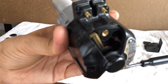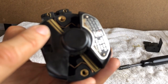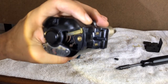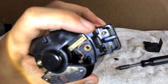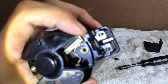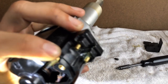You can see the commutator in here. That copper ring is our commutator. On this side I can also inspect the brush. Using a flashlight at the right angle — look where I'm shining the light — the tip of my finger marks the top of the brush holder. Follow that middle line: it's dark, then right around in the middle it starts to look gray, and that's the brush. What a clever thing to be able to look at the brushes without taking them out — very useful.